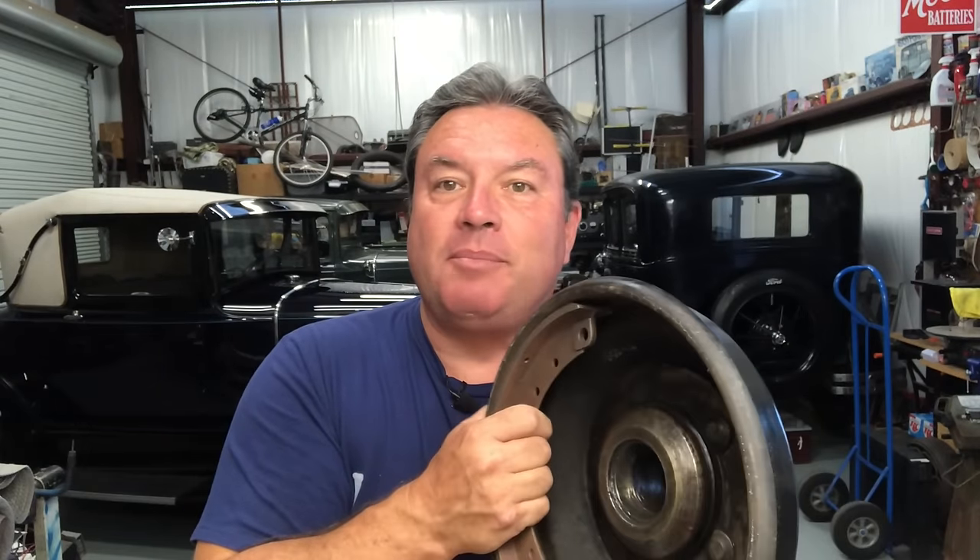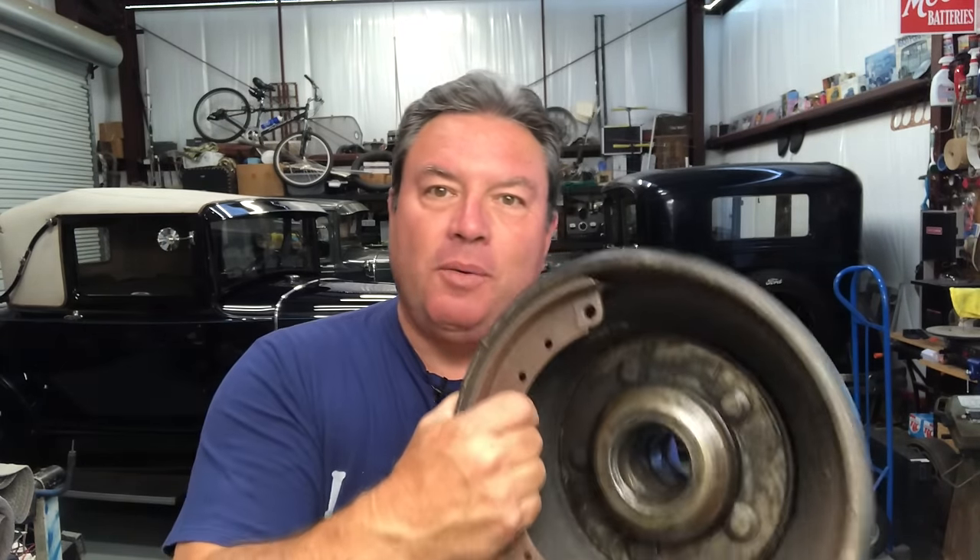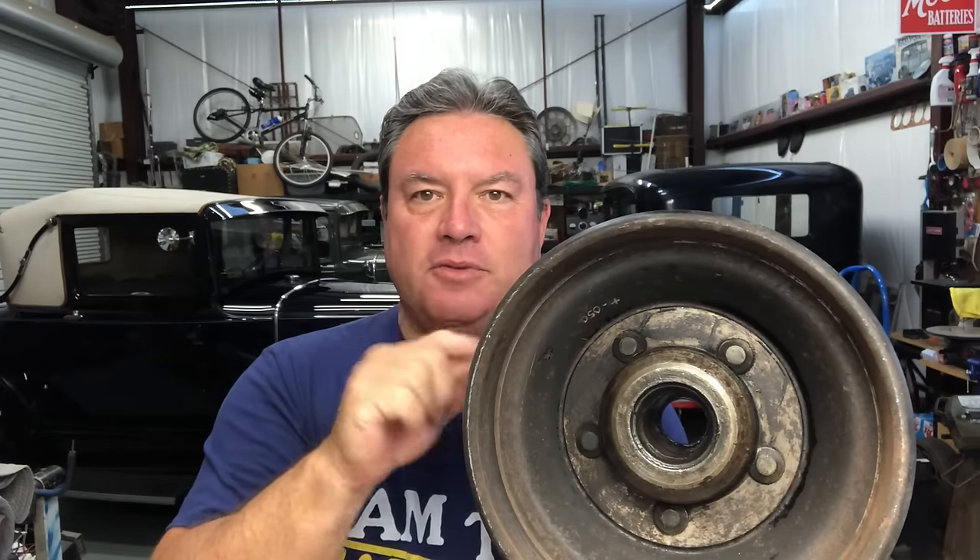Here's an example of a woven type. As the brake shoes push against the side of the drum, they generate heat — converting the forward energy of the car into heat. That heat has to go somewhere, and it builds up in the drum. From basic science, when things get hot they expand and when they cool they contract. So when a brake drum expands, it gets bigger in diameter. The more heat in the drum, the bigger it gets, meaning the brake shoes have to push out even more to make contact. You get into a vicious cycle.